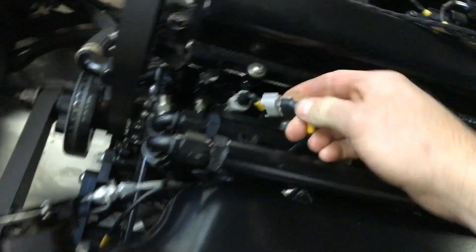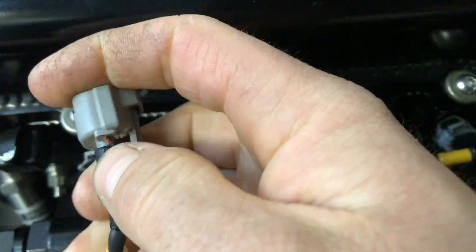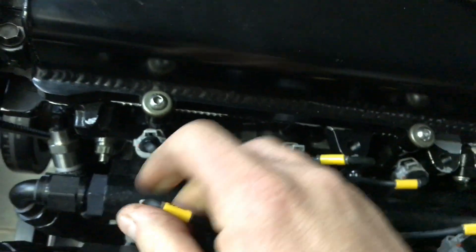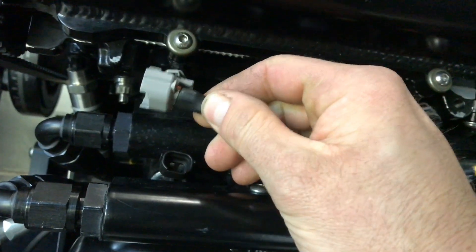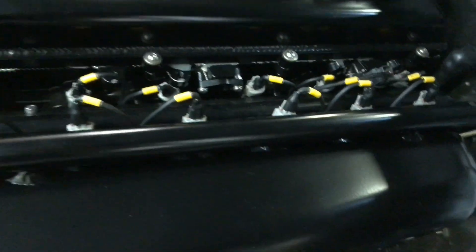The Autosport is pretty easy to get back in line — once you get the keyways lined up, you'll hear it click when it's nicely seated. We've got 12 injectors on the car, and we put a boot on every one of them. It's common while racing that people move fast and pull wires right out the back of a connector. On the injectors, I went ahead and booted these so they'll never get messed with — everything is potted and terminated correctly, so we won't have a wire wiggle loose. That creates more integrity in the system.